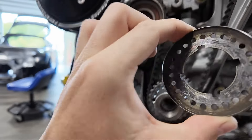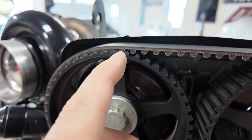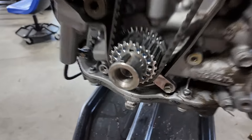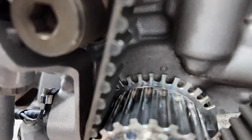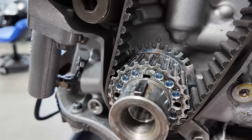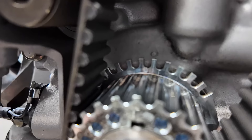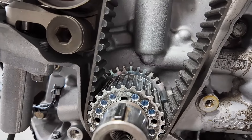I need to pull this off, find the pin, and then decompress this slowly - or I might just buy a new one. I also need to get a belt sometime. I did line up the tick marks here - one there, in there to line up the timing. I will have to recheck it all again because I don't trust that. You can see down here - this dot and dash should be lined up, but it looks like it might be a tooth off, which is not good. I need to look at that because that's a little disconcerting.